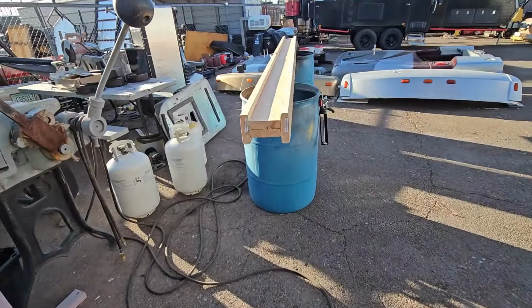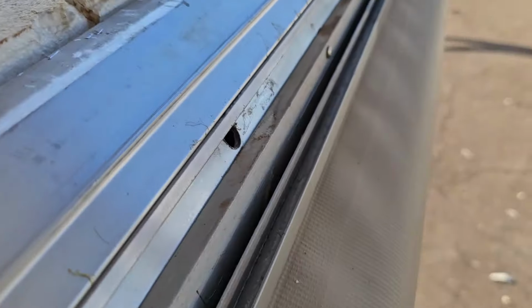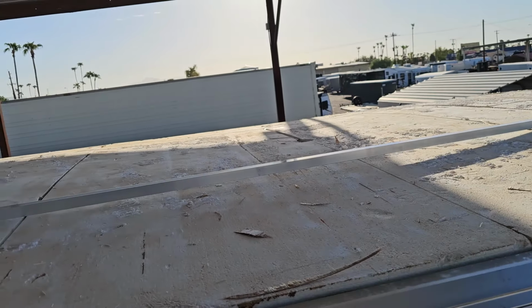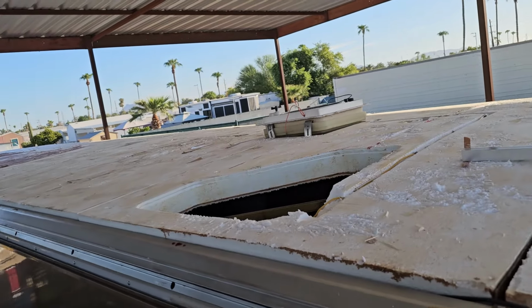On every roof job we do now, we add structural support underneath the roof to keep it from sagging as we're working on it, so that when the new roof is installed, there's not a gap or a low point in the middle of the roof. It's a trough.